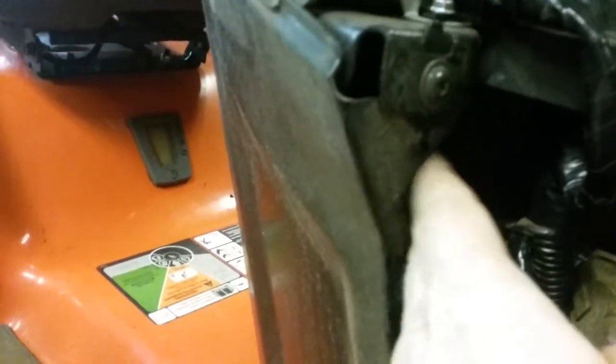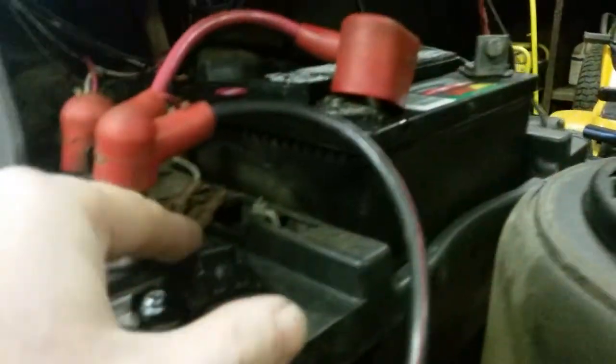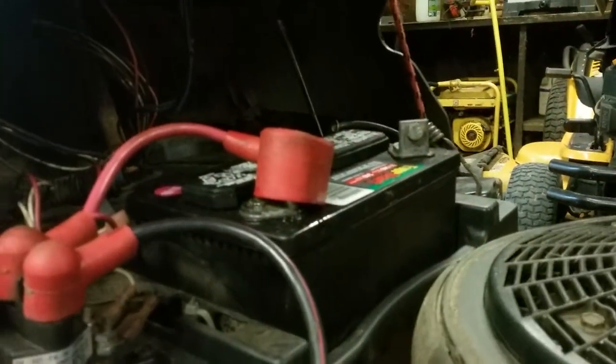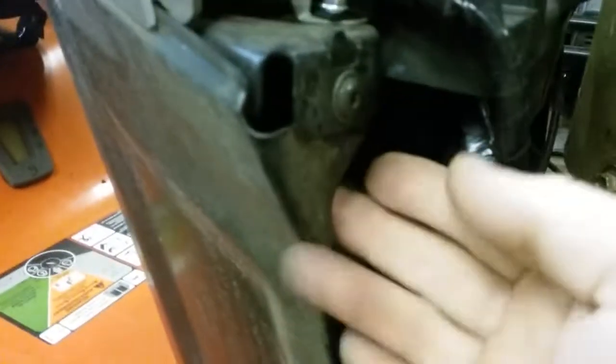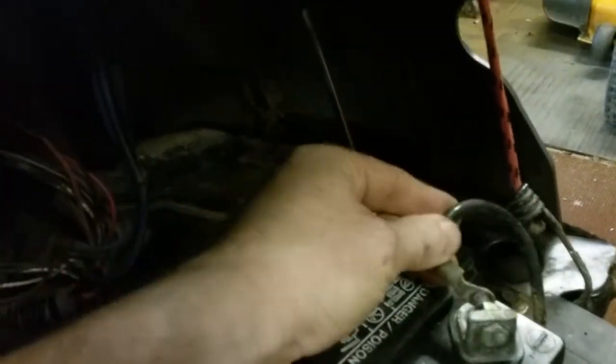The wiring harness is right down in there now — pulled away from the frame as you can see, not rubbing. We went ahead and mounted the fuse holder right here to this bolt. All you've got to do is flip that up, open it, and take your fuse out and put a new one in if needed — it's right here, easily accessible. Before, it was tucked back behind this panel right in here, clipped on near that hole. We've got everything taped up and out of the way. I'll put the battery cable back on, turn the key on — everything sounds okay.